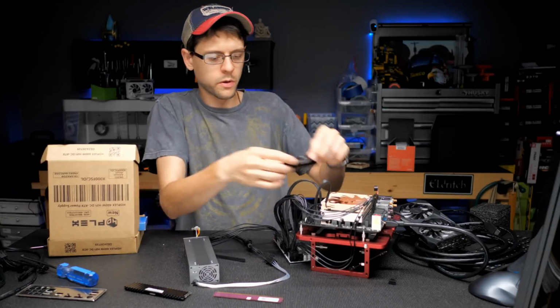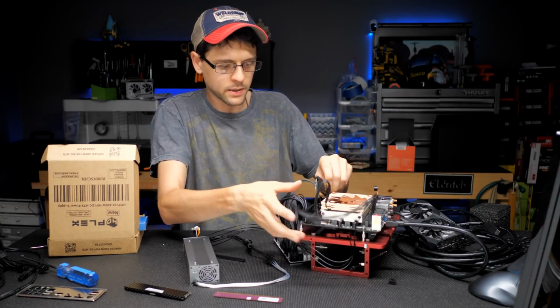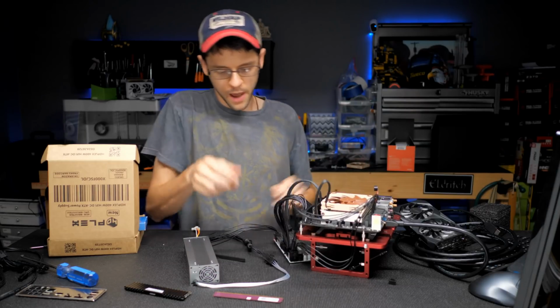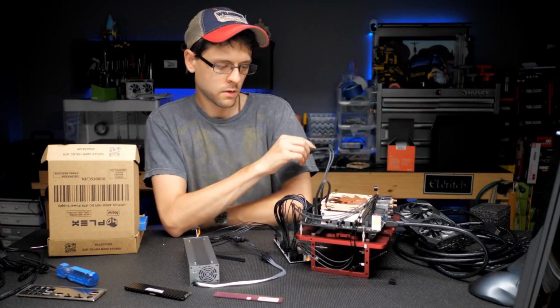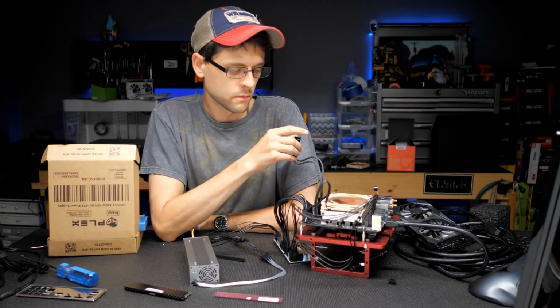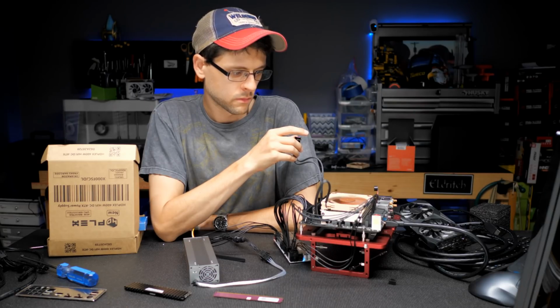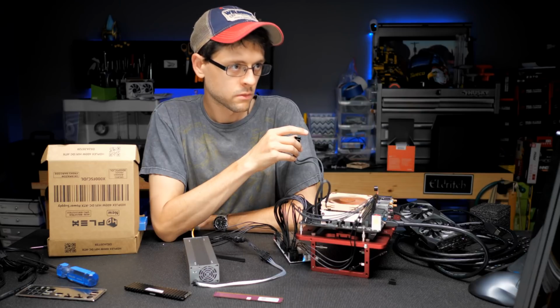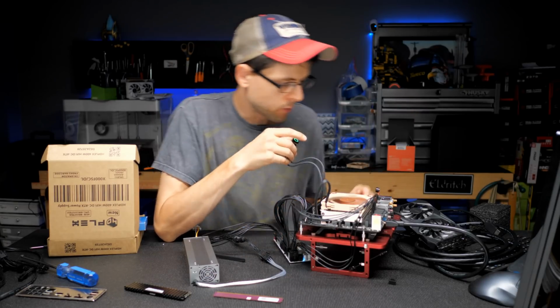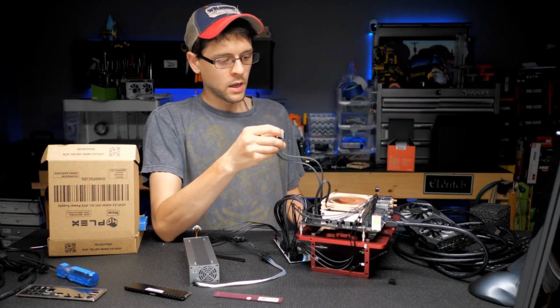It could be too that this motherboard doesn't like this RAM. I didn't look at the RAM compatibility list. I usually get Vengeance because it's inexpensive and I've never really had a compatibility problem before with it, but first time for everything. It sounds more promising. It is odd though that the speaker, if this is the speaker header, wasn't beeping at me. It posted with one stick.